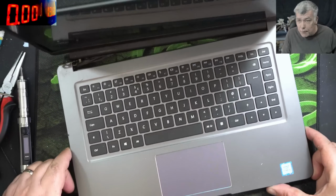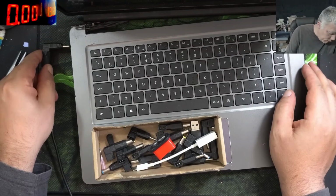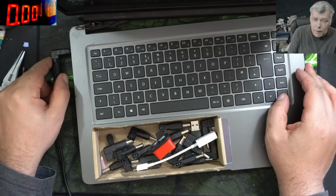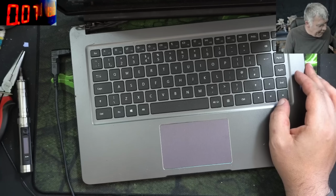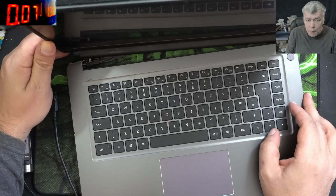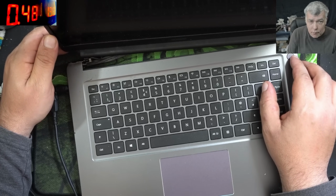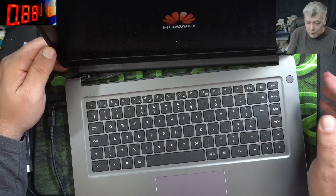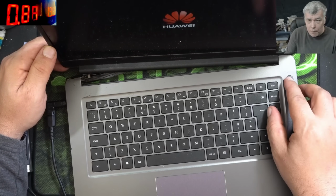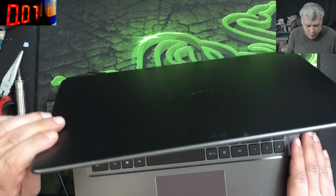Like before, the first step is to check if the laptop is working. Let me plug in a charger. And the laptop is doing nothing. Huh? Wait, 70 milliamps. Maybe the battery is just low. Pressing the power button. Yeah, the laptop is coming on. Check that. We have a picture, you can see. So actually the laptop is working. Not charging is not our problem. The job is a hinge repair. Probably discharging. It does the pre-charge current most likely.